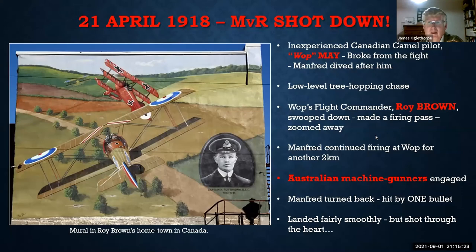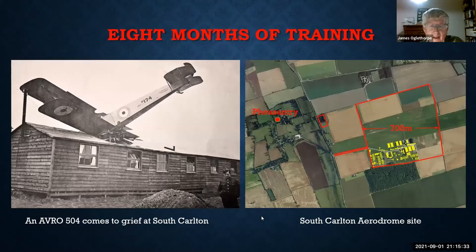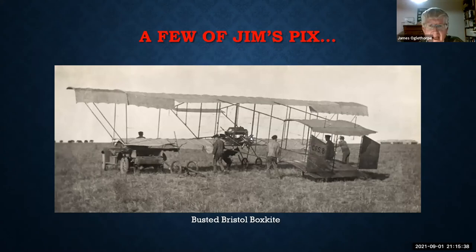Yeah, that was me. You said radio. You said rotary engine. Yeah, right. So I'll tell you the difference between a rotary and a radial. Now, this is a rotary engine. That is, the actual cylinders of the engine rotate. The only fixed thing is the crankshaft in the middle. Now, this was a very common sort of engine in World War I aircraft.